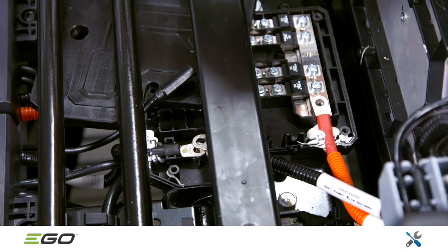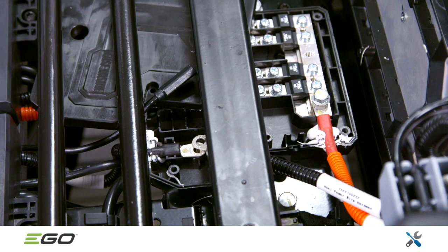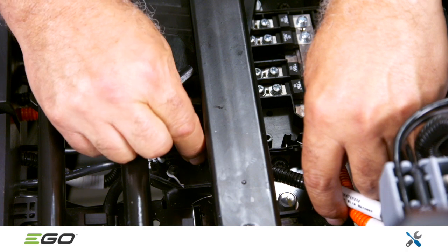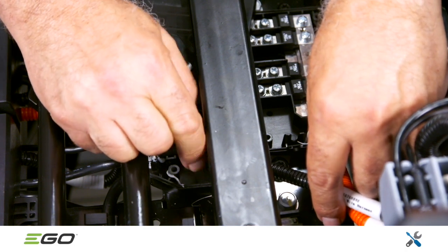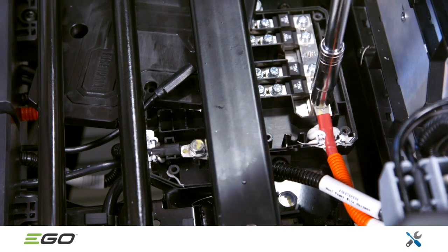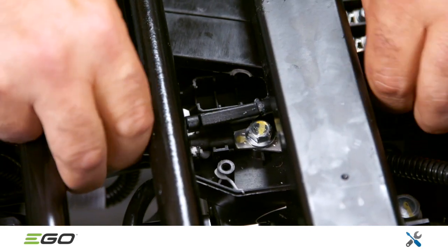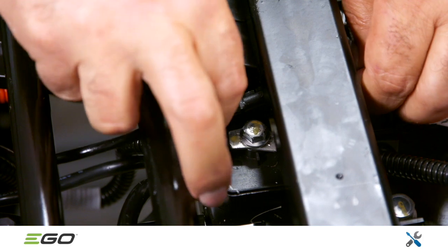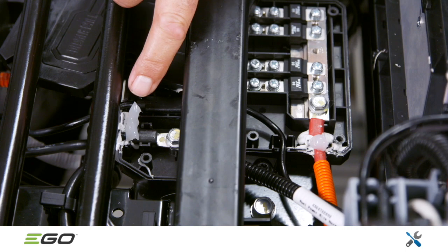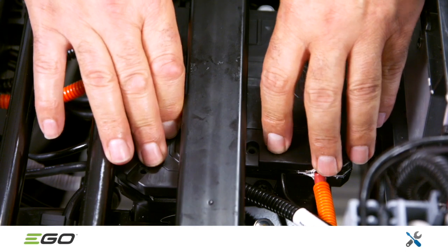Using a 10mm socket wrench, connect the wire harness from the battery box assembly with the fuse box, starting with the orange wire. When connecting the black wire, it should be seated under the eye connector and routed into the slot that comes from the battery box assembly. The wire harness also includes the Type-C plug. Add dielectric waterproof grease before connecting it. Also apply waterproofing sealant where the orange and black cables enter the fuse box to seal the gaps. Slide the cover onto the fuse box bottom and tighten with the 5 T20 Torx screws.